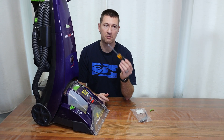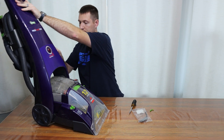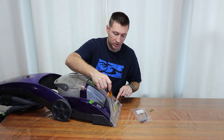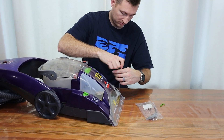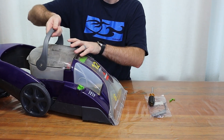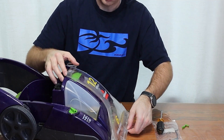The only tool that we're going to need is a Phillips screwdriver. Let's first start by laying the machine down. There are two screws here — just Phillips screws. You'll pull this tank off here and set that to the side, and then this panel is going to come up.